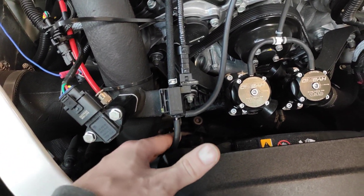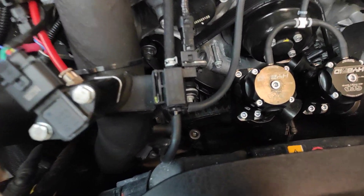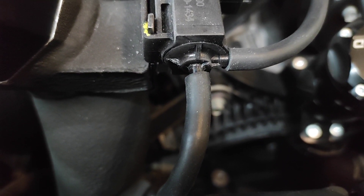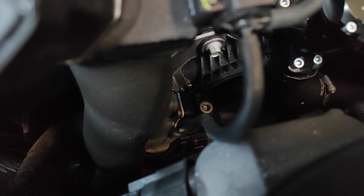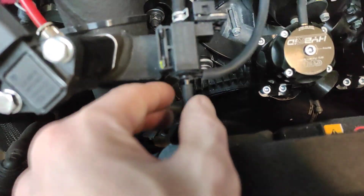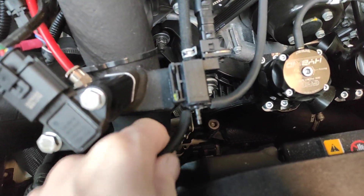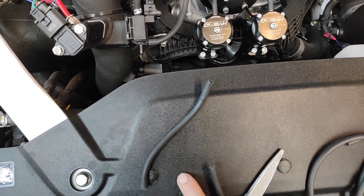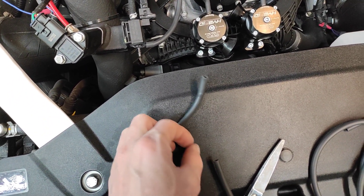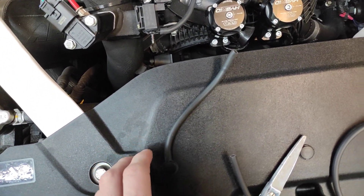This lower line here is the one you need to disconnect. The top barb is plastic — be very careful, it's not very strong and you can snap it off. The lower one is metal, a little stronger and more resilient, but still take your time pulling these off. I already pre-pulled them. This is not the stock hose — I've replaced it a few times. This one is actually being run for the methanol controller that runs off both vacuum and boost.